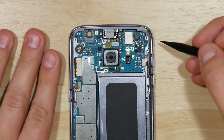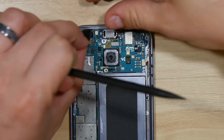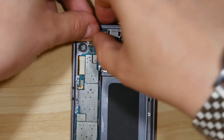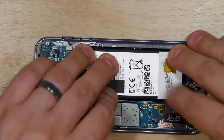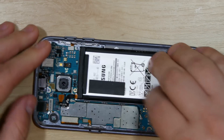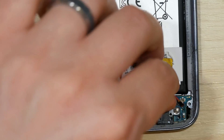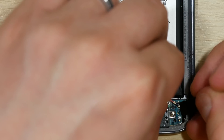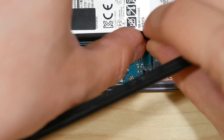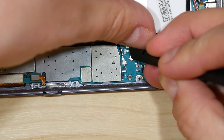We also need to make sure we put in the front-facing camera — can't leave that out. Put the battery in, make sure you've flattened it back out if it was bent in any way during removal, and connect it to the phone as well. Put our little wire connections on — red goes in the bottom right-hand side of the phone and to the connection closest to the battery on the logic board.